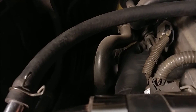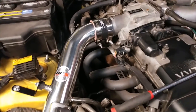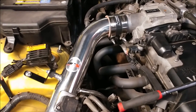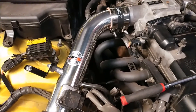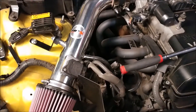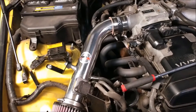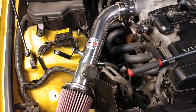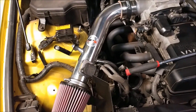So you're just going to feel back there with your finger and feel a little gap. As long as there's a gap in there, the heat shield's just going to slide in. Now, you don't have to take off the intake, but it's going to give you more space. I'm going to do it without taking the intake off because I just did the tutorial on this HBS intake and I kind of don't want to take it back out. So I'm going to slide it under there without taking the intake off.